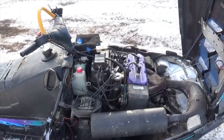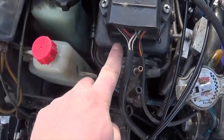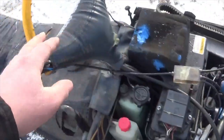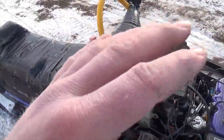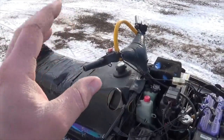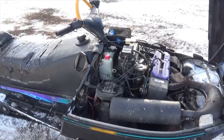In my eyes you're gonna have less chance of popping it. In a nutshell, what this device does is basically just adjust where the carburetors vent — either into the air box or under the handlebars. If you're venting under the handlebars, you get the opposite effect of venting under the hood: the faster you go, the less atmospheric pressure there will be. It's something about the air whooshing past that almost creates a negative pressure. I don't know a heck of a lot about that, but I just know that if it's venting out there, the faster you go, the less atmospheric pressure at the carburetor bowls. So the faster you go, the leaner the sled will be running.